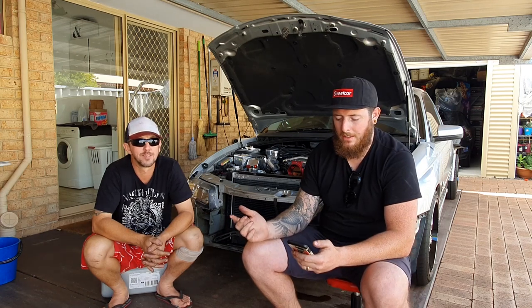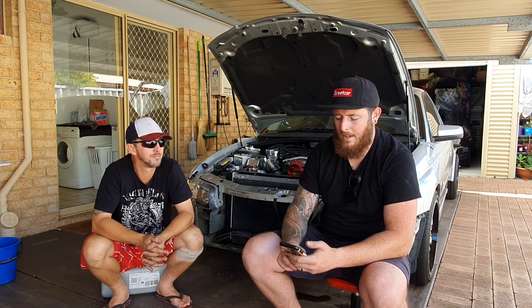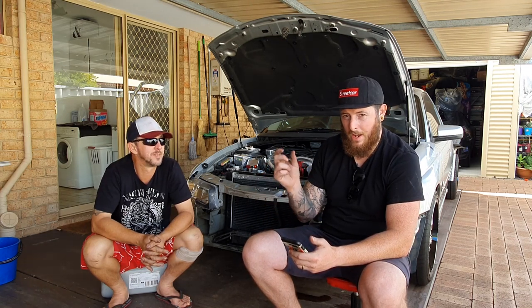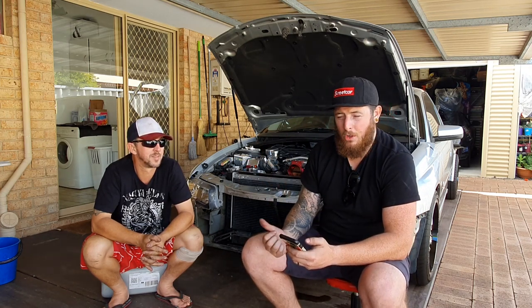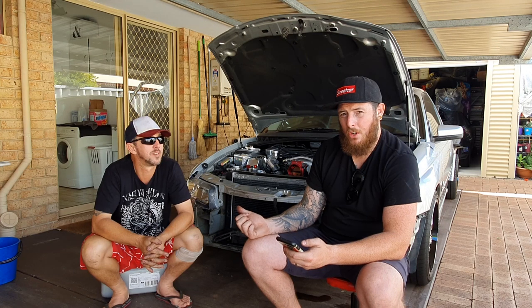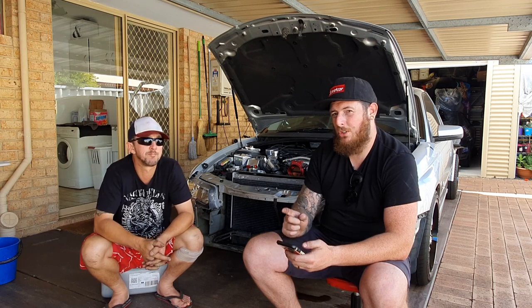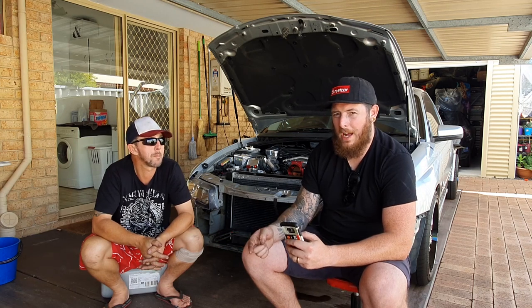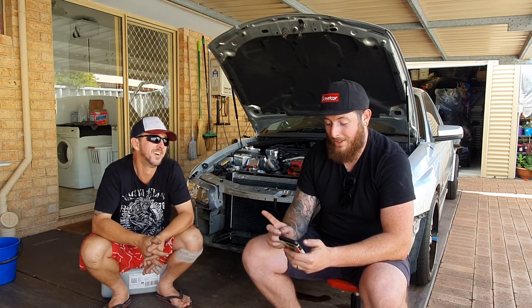And that's using BTR double valve springs, and we used a Mace Engineering trunnion bearing upgrade kit on the stock rockers. That will help in case later on down the track one of the bearings fails, we shouldn't have the needles go through the engine. We used a Rollmaster timing chain kit, a Rollmaster red single chain, adjustable, and a Melling high pressure stock volume oil pump. The part number is 10295. We weren't sure which part number to get, as we've heard a lot of people use Melling oil pumps when they do the turbo thing, but after a lot of research, 10295 is the one that you want. Highly recommended.